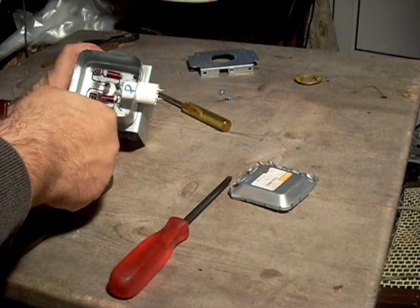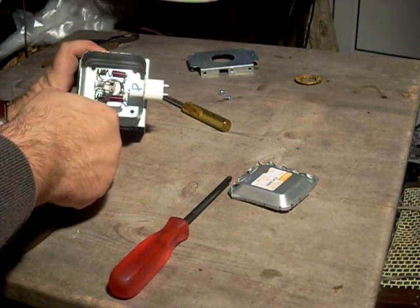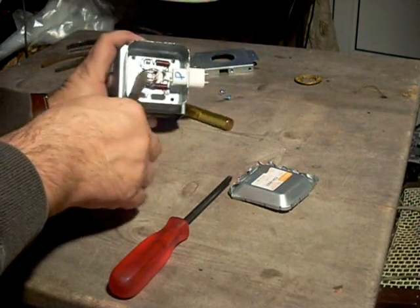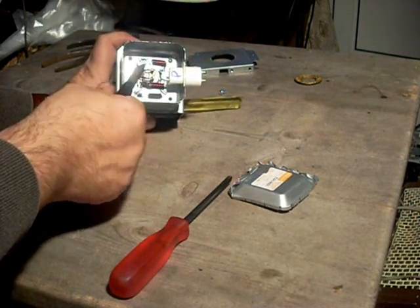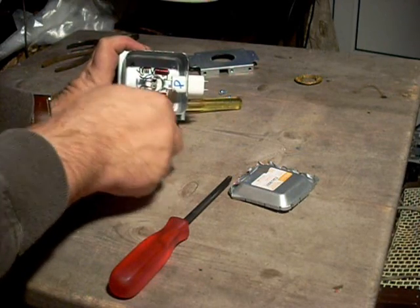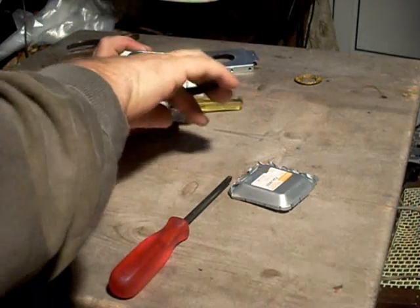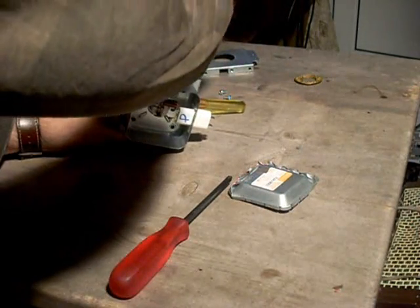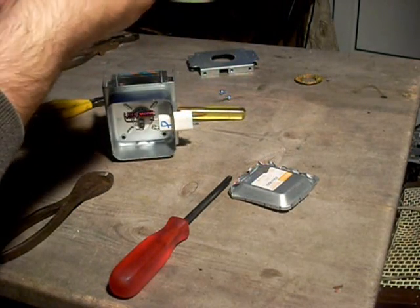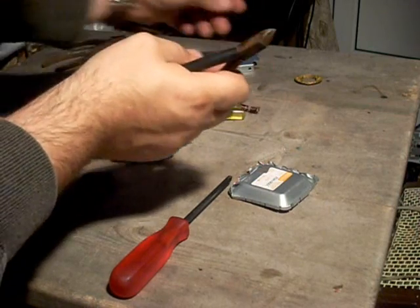These are series inductors feeding the filament current to the magnetron. Now the reason I believe — and it's probably quite an educated guess, if I do say so myself — is to prevent any high frequencies leaking back down the transformer winding wires. I don't know whether they're copper or what... what these cores are made of actually. It could be copper; yes, I think that's copper wire.